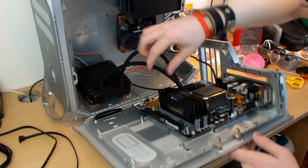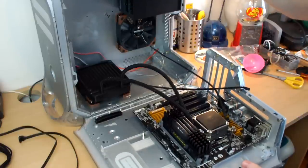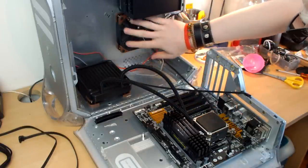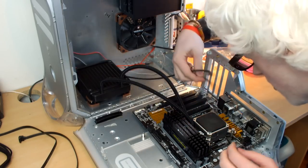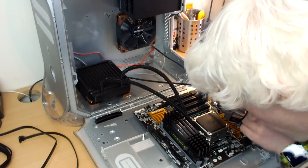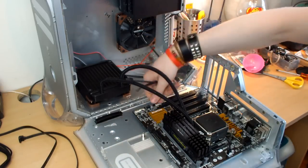The pipe is at quite high tension when the case is open, but when it's shut it's not under any tension at all — it's just free to do whatever it wants. Because of all these cables building up, I do have a fan guard for this one so I will be putting that on. Now I reckon it is time to get the hard drive cage in and the two Western Digital Caviar Blacks. We'll get those in the bottom before we get too many things in our way. There are fan connectors on the board and we should be able to plug them both in without extensions.